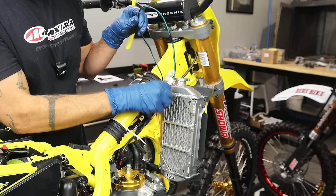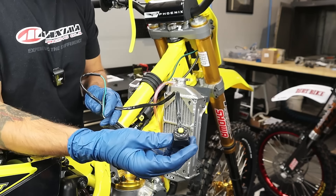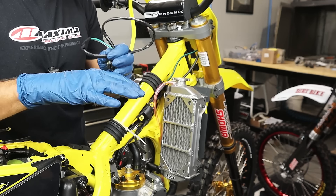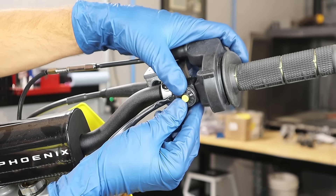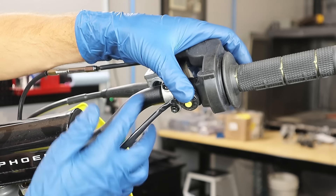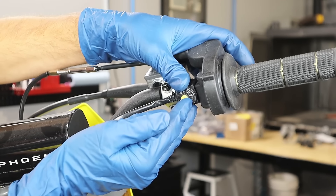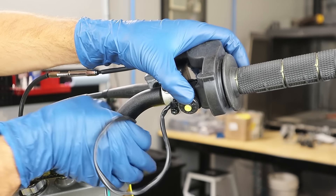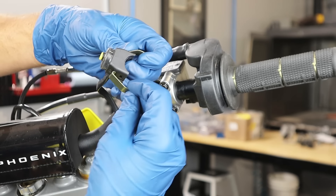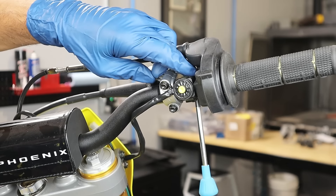One of the last steps, aside from the battery, is to install the magic button. At the point where we V'd our wiring harness, I snuck the charging system connector and the magic button wiring loom through the frame right behind the coil, up behind the number plate. Now we can take the magic button up the handlebars, figure out wire length, and then throw the battery in. I'm going to mount our magic button right here — there's enough clearance under the wire where it exits to clear the bar mount for the brake master cylinder. This keeps things decluttered — same as some new 450 or 250 four-strokes — and keeps it away from the kill switch.